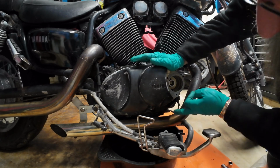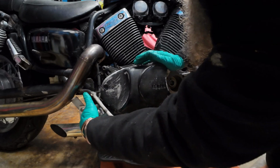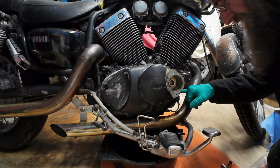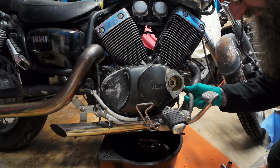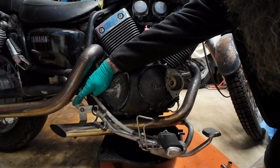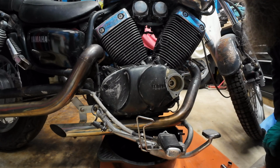Now underneath, some of the bolts have got wire hanging clips on them, so I've got to make sure when I undo those that I don't lose the clips, because they're holding some of the wires. To get to it, what I've had to do is remove, you see that, the footrest brake assembly. From the front was a 14mm bolt, undone that, and then a 17mm at the back, that's carrying the exhaust hanger as well, just to give me room to get to these bolts underneath. So I'll undo those, and then we can have a look at taking the casing off.